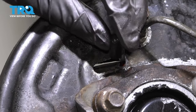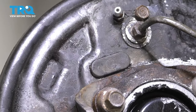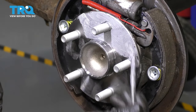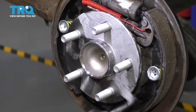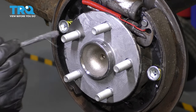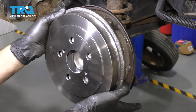With everything back together, put back this rubber cover that covers up the adjuster. If you need to readjust later, just remove it. Now let's coat the hub in some anti-seize — that way the drum doesn't seize on here and this will prevent rust from building up. A thin layer will do; you don't have to put a lot on. Make sure you go around this inner ridge here. Try not to get it onto the lug studs or the threads — those should stay dry. Install the drum.